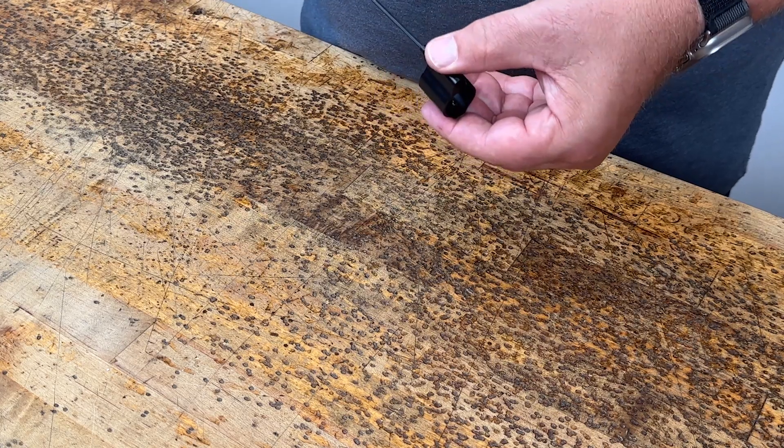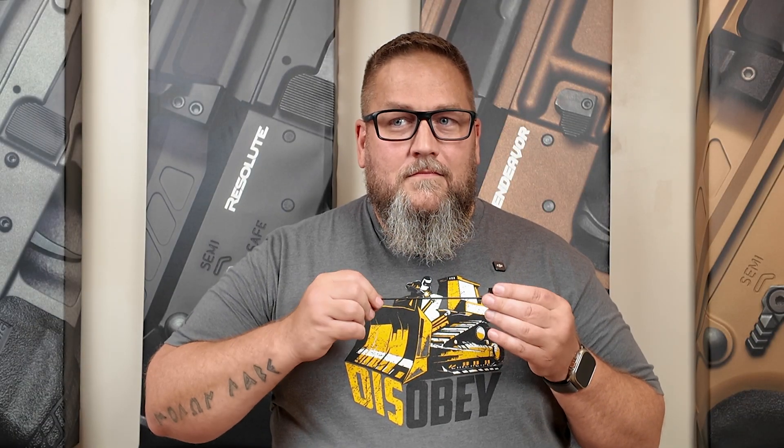When it comes to adjustments, there are 20 adjustment points here, and they are very tactile in feel — you can hear the detent click. You can definitely hear the detents when they click, and they are very tactile feeling so you can feel them through the wrench. If while you are adjusting it you don't hear or feel it clicking anymore, that could be one of two things: you've got it bottomed all the way out and completely closed off, or you have it opened all the way up and you are just about to pull the spring out. So be mindful of that — if you're not feeling the detent hit, you're probably at the extreme one way or the other.